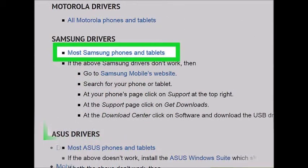Download and install the Samsung drivers. If you haven't connected your device to your computer before, you'll need to install the Samsung USB drivers. The quickest way to do this is to download the drivers from Samsung — the link is in the description. Download the zip file, double-click it to open it, extract the installer, and run the installer to install the drivers.